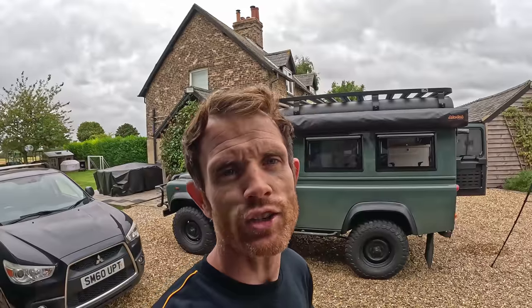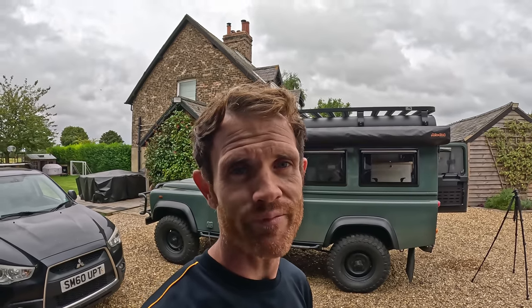The last job I've done is change the gas struts on the roof. Fitting the roof rack made it a bit harder to lift because of the extra weight, and with solar panels and surfboards going on we needed to upgrade the springs anyway. I've got four springs — there's conflicting information because one company says change two, another says change all six, so we've gone for four and might change the back two helper struts once we've seen what it's like. I did one side and it was an absolute nightmare — you've got to use a ratchet strap to compress the struts to get them on.